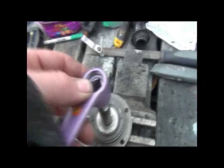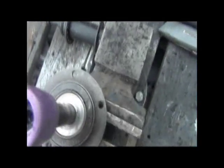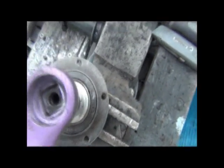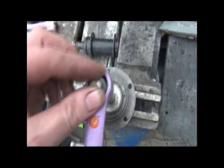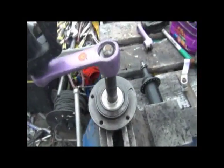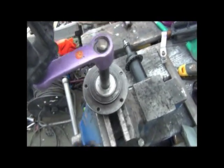You can use a file or a grinder, then put your crank on — no problems. Make sure you keep about 3 or 4mm so it slides on and can tighten up. Then simply put those on — which comes with the cranks anyway. As I said, you can make these longer; they're only about 10 centimeters so you can make them 12 or whatever you want. Our axle now looks like that with the ends squared off so we can get our pedals on.